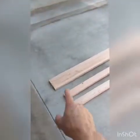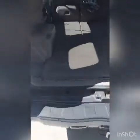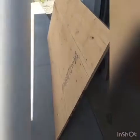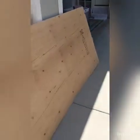My plan today is to use a 2x8 — gonna cut it into a couple pieces and set up in three rows: one on the left side, one in the middle, and one on the right side. We're not going all the way out because I want to have my seats fold up when driving to the camping site. I'm gonna build 2x4 supports in the back for the second part that slides out. I got a three-quarter inch thick piece of plywood so it's a lot more sturdy. I'm planning to sleep there with my wife — two people — so it needs to hold up.